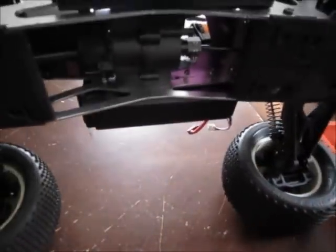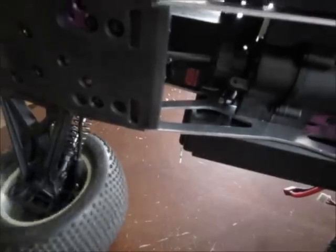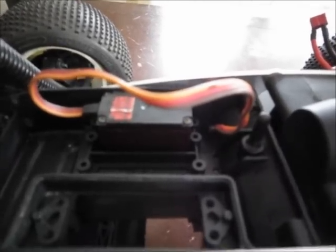After all that, I got my motor mounted and also got my steering servo in — it didn't come with any linkages when I got the truck. It's a Z9100S steering servo. It's a speed servo — I don't have a lot of torque — but this thing still cranks out 190 inch-pounds of torque, and if you know about servos, this is one of the fastest you can get: 0.06 transit time at 6 volts. It's insanely fast. It has 190 inch-pounds, so it seems like it can turn these big tires with no issue. I'll keep it in there, but if not I'll run my servo saver loose so it's not too brutal on it.